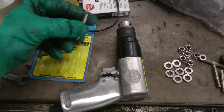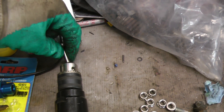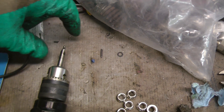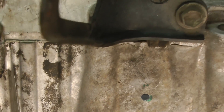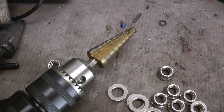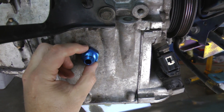I'm going to make an indentation in the center of that magic marker mark using a spring loaded center punch, and then use a machinist centering drill bit to locate the initial hole. This block casting is thin enough that I'm just going to go all the way through using that centering drill bit. Once I've got that hole established, I can switch over to a step drill bit to enlarge the hole so that the fuel cell fitting will return oil into the block.